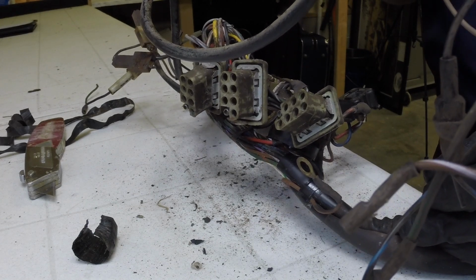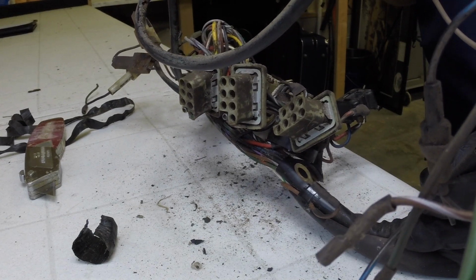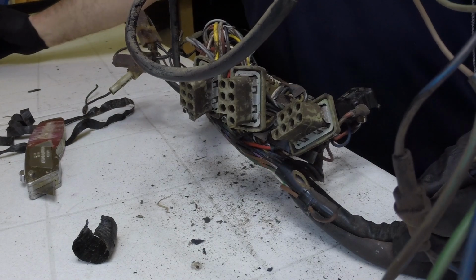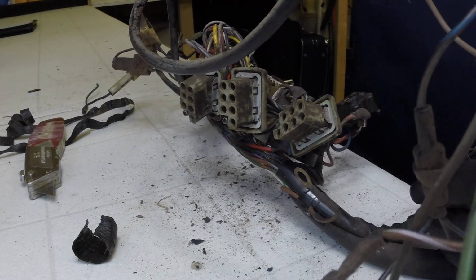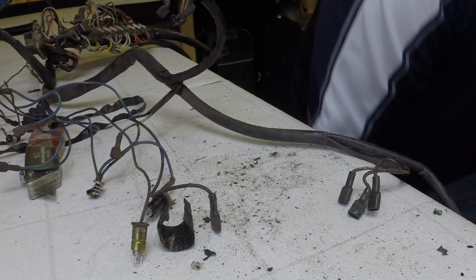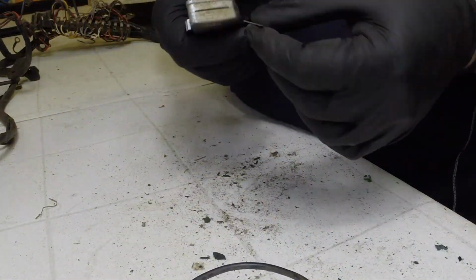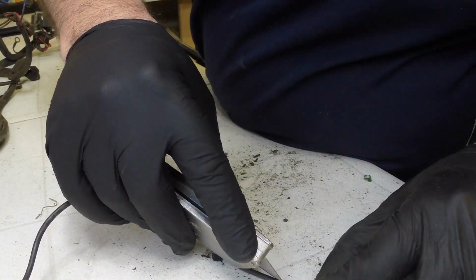If you see on those little connectors there, see those little silver things that are underneath them? Those are the tab holders that I was talking about in the last video. Just got to be careful to not pull those things off and break them. So there's three of them and there's four tangs per connector. So you just got to be careful, because if you break those things off, you'll never be able to get those things secure.